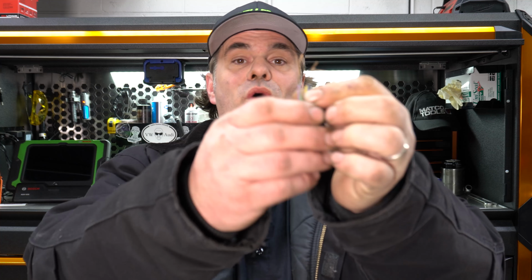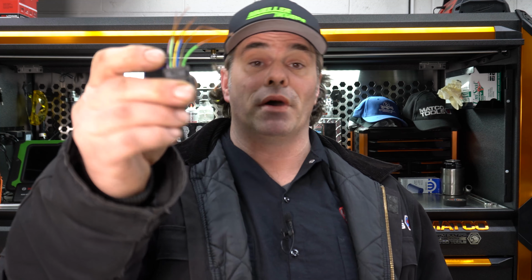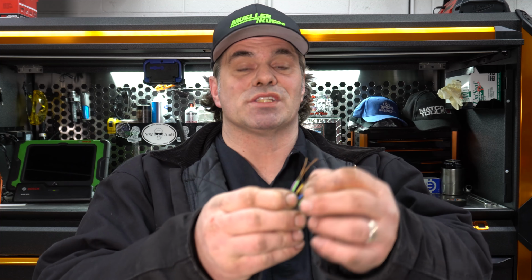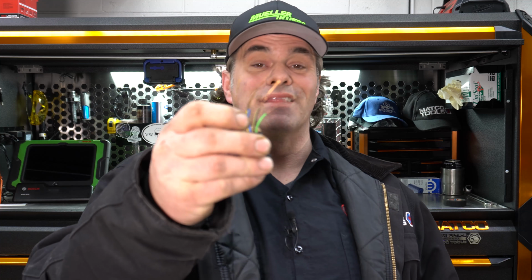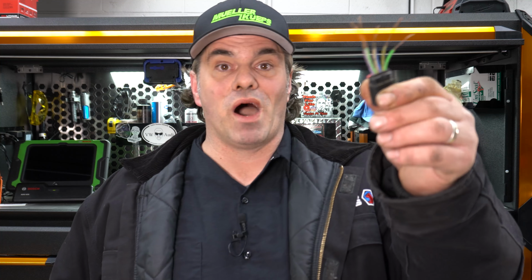Well, this is how it was, except there was tape around them. And they were still connected, but instead of fixing it right, all these wires were just twisted with electrical tape. That is not the right way to fix bare wires. It wasn't even a good tape job. It was the cheap stuff, that slimy, nasty Harbor Freight stuff, not the 3M good stuff.